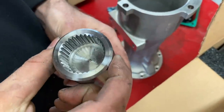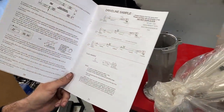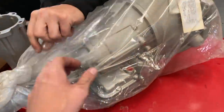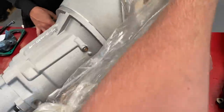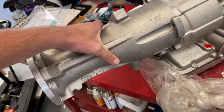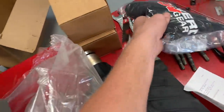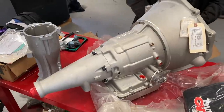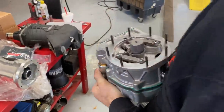Look at this coupler — that's a serious coupler. They opted for a solid piece rather than a three-piece, which would introduce multiple degree offsets. They walk through the El Camino's powerglide, explain they'll replace the tail housing with this unit, and the Gear Vendor attaches to the back. The controller — which comes with the kit — is what activates the Gear Vendor, engages the clutch, and locks it into overdrive.